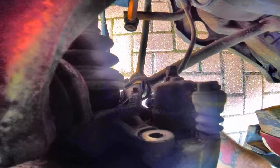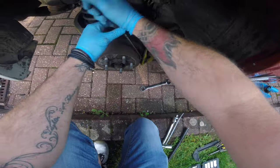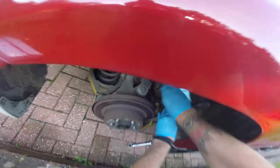We're going to have to push this piston back because these pads are pretty damn worn. I think these are actually the original discs from the car. We're going to lever this caliper back a little bit because it's locked on — these pads are pretty toast.